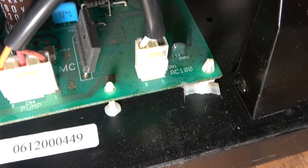Let's study the circuit a little bit. We know these are the outputs. This TRS, I think that is the transformer. These, I suspect, are outputs or interconnects between things. Yeah, that's all that is. They're just interconnects. That's why it doesn't matter which of those goes where, because all they do is link together. This is the mains input side, I think, and it goes through chokes and capacitors and then off to the transformer via one of the other connectors. That one, I think. So we can ignore that side of it. This is the bit that we're interested in here. It looks very hot and bothered over here.